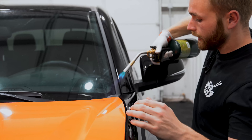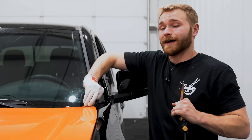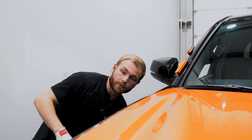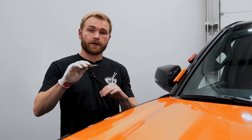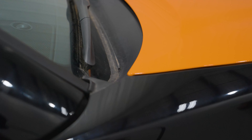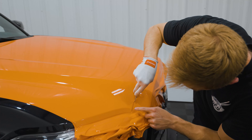Now that we have our back edge and side edge cut, we're going to take our torch and heat those corners that we stretched. What that does is shrink the film around the corner so we can get a nice paint-like finish around those corners. The film will shrink a little bit around the corner, and that is exactly what we want. If there is any excess on the back, you can take your knife and cut flush with the bottom edge of the corner. Now that the excess is trimmed off, you can see the corner has shrunk around and the film gives a paint-like finish with no creases.